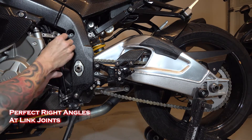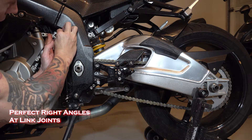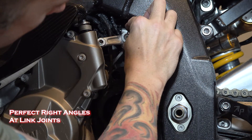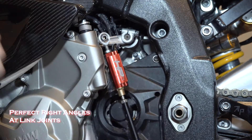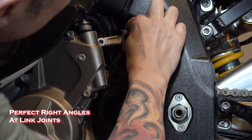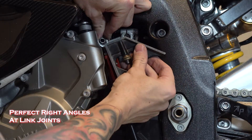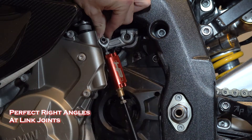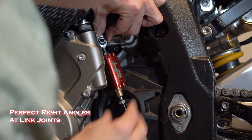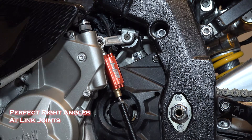I took this bolt out so I can move that aside. Now I'm going to try to take this off and see if I can rotate it over one tooth. We started here and I was able to move it one notch, and it looks like everything clears. That little one tooth might make a big difference. If I use my right angle, the previous position was a little over 90, but going back one notch — which is still one away from the original — that's really close to 90 degrees. I like that. So that's only rotated one tooth over, and that's where we want it.